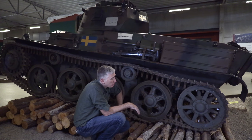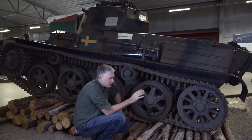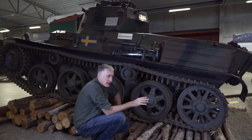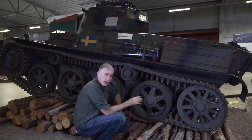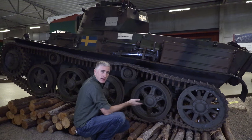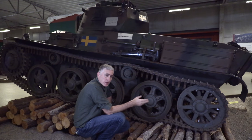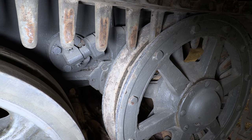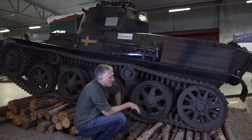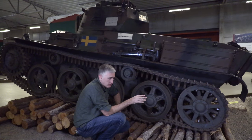At the very end is the idler wheel. It's not really a trailing idler — it's on the ground in this display vignette because the vehicle is raised up, but on level ground it wouldn't contact the ground. However, because it's likely to contact the ground in situations like mild off-road use, the idler wheel is on suspension of its own — a swing arm with a bump stop in addition to the track tensioning extension system. Over the years the Swedes would play with the idler location, but in the L60 it generally maintains this fairly low position.